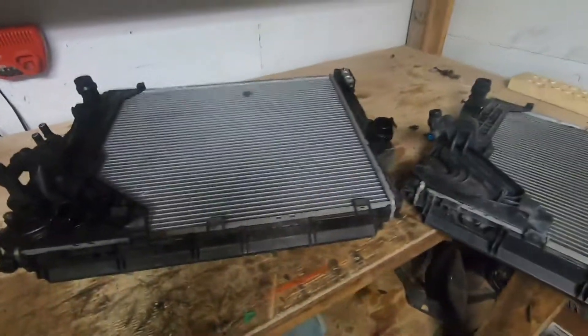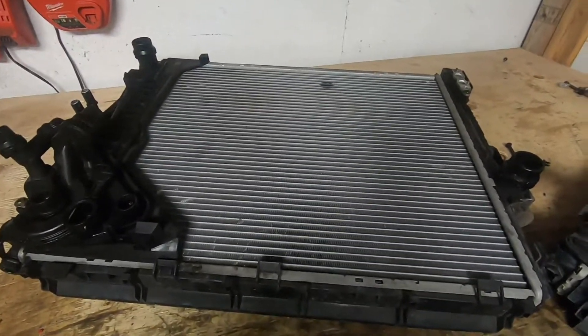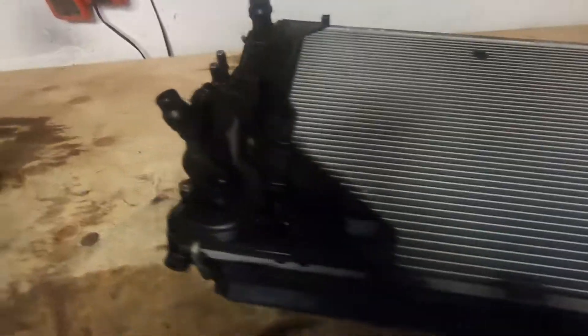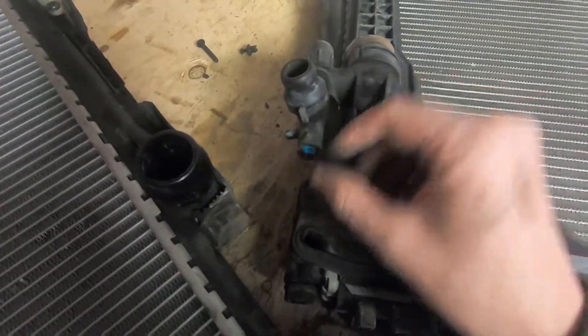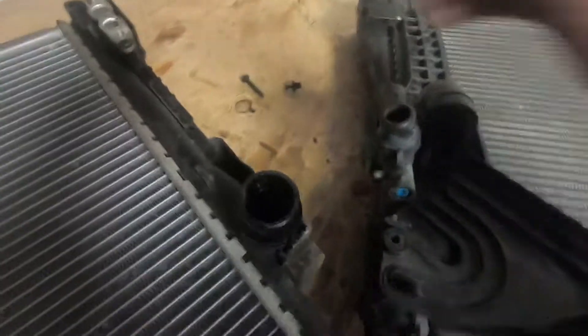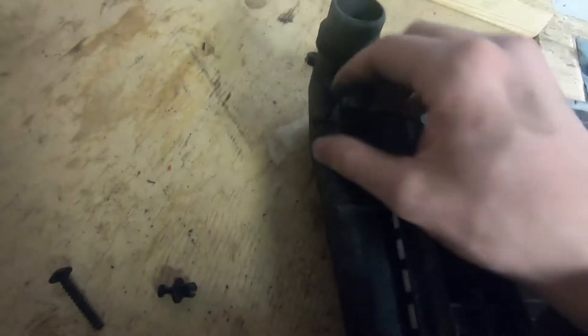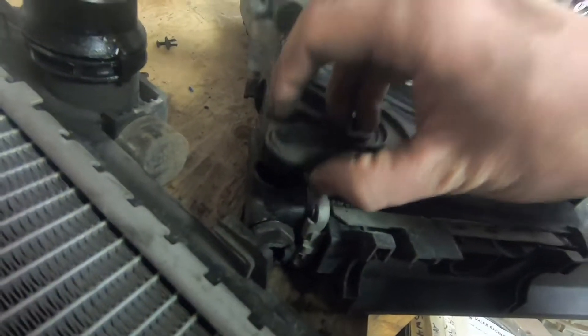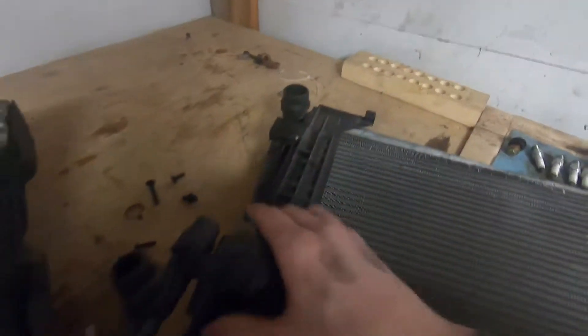What you need to do is use that plate from your manual on the automatic rad and it will be essentially just like a manual rad. To pull that off, it's pretty easy. There's one bolt down here right underneath where you see this blue little drain plug — pull that out. There's also one more right up on the side here; this old plastic mounts to the side of the tank. Pull that out and then you have to pry it up because there's a little overhang that holds it in place. You just pry this up out of its place and then slide the whole thing up — it clips in down here and also clips over the top part of the rad and you will have it out.